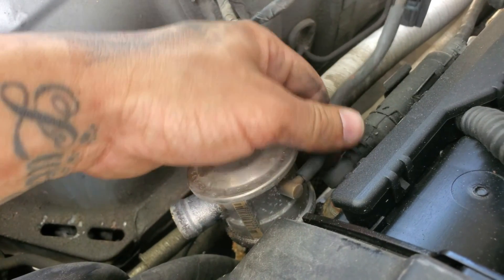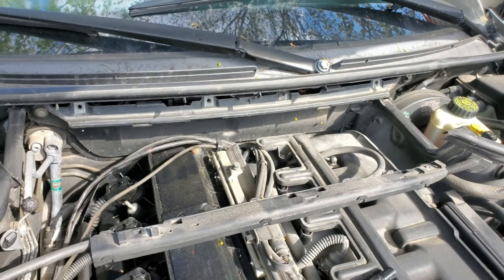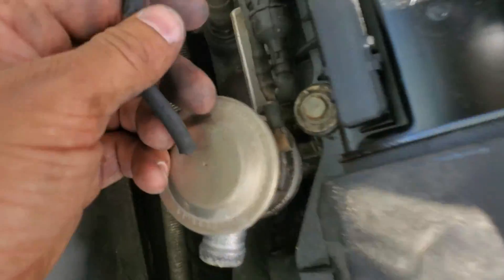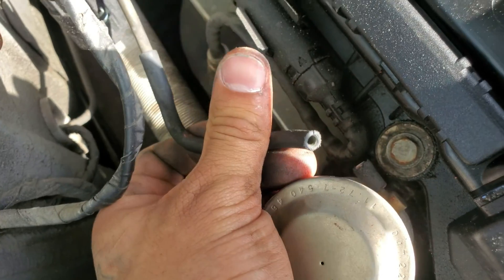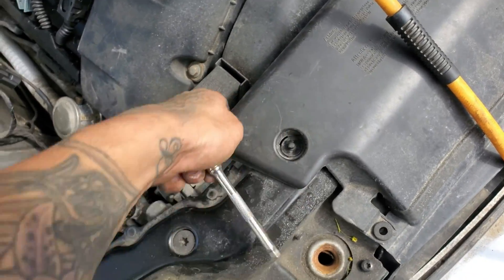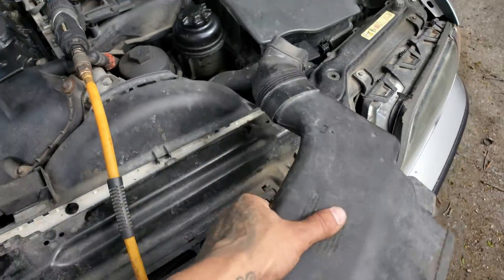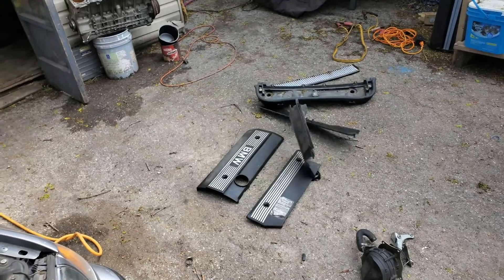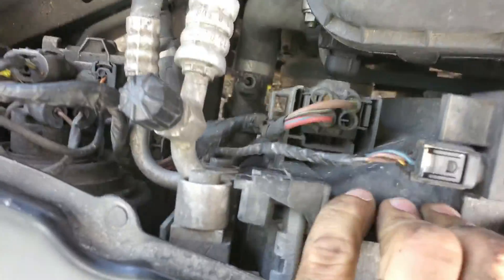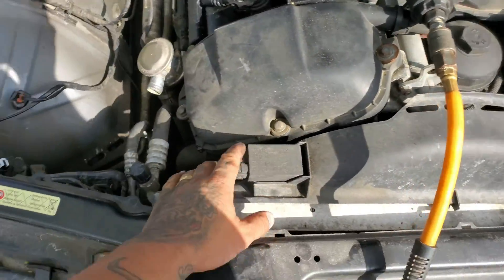On this EGR valve there's a little hose that runs into the back of your intake manifold. If you do a secondary pump delete you need to plug the little nipple on the back of the intake manifold. For this case that is actual trash — it just snapped right off, barely hanging on. I'm just gonna take this intake piece off here — I won't be needing that either. Just like that, that's how it comes off. Don't do that if you're trying to save stuff. I also noticed there's a missing bolt — please don't drive like that. If you're missing something, find a bolt that fits.